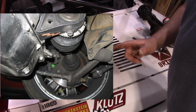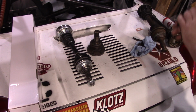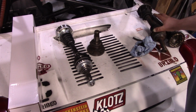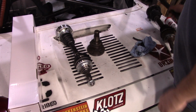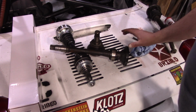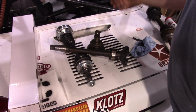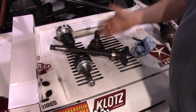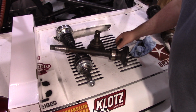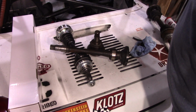And then if you look again in this picture right here, I was looking at this and I realized back in 2009, the axle that I used for the passenger side supported axle was a second gen. It was one of these with the snap ring. Now, that's not the style that's on there right now, but I remember that bracket was just the bracket that came from the car that I got that swap from. So the 2010 Camry with a manual transmission, which is kind of rare, for some reason uses this old style snap ring with this bearing. All the other ones use the newer style.